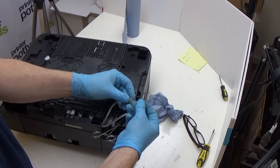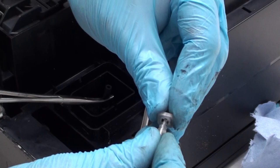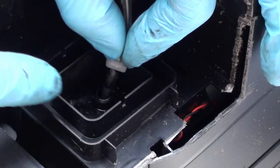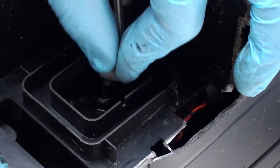To show you with this piece of clear tubing — you want your barb to go into your tube to about there. The reason for that is if you get it to that level, you can see it's wider down at this side, it's thin, and then you use the edges of that hole to act as your brace — your other pair of fingers.